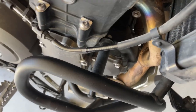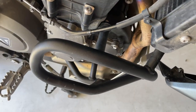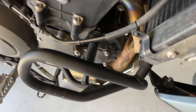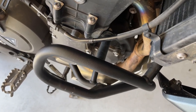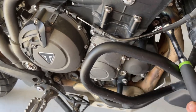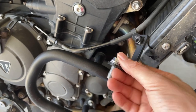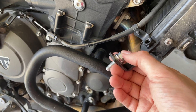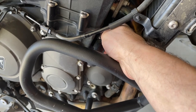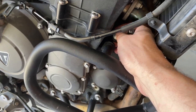First step is to remove and loosen the fixing from the lower dresser bar — you use a 12 millimeter for that. You take the bracket that comes with the kit and the M8 by 25 bolt and M8 washer they give you, and mount it to the lower dresser bar front mounting here. Be sure you don't tighten it all the way down at this step.